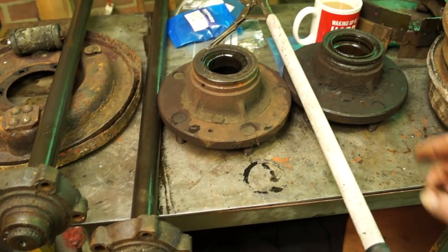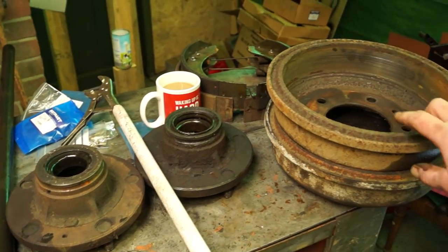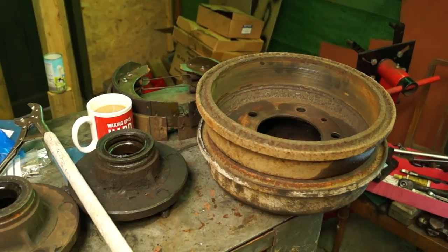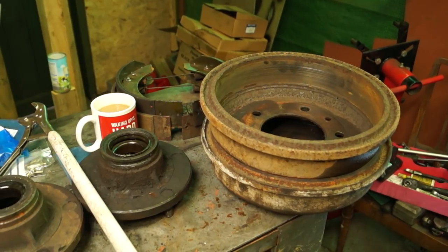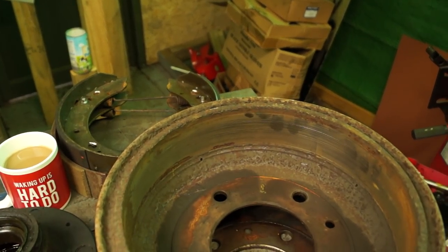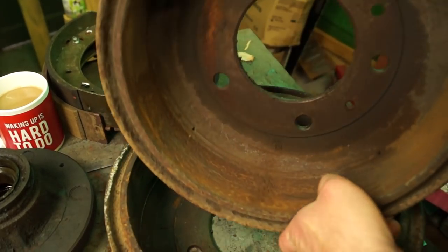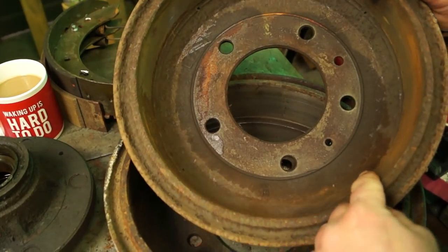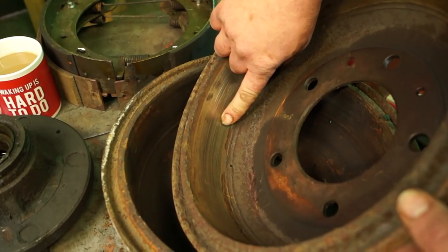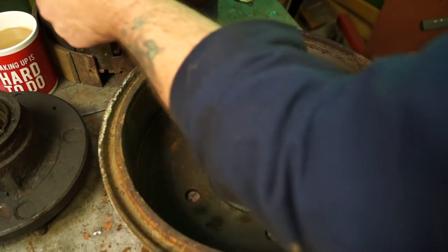I have the components laid out on the bench. I have a hub seal leak here — you can see that compared to the dry one. And then of course I've got the brake drums. The condition of the brake drums is very, very important, especially the working surfaces. I'll briefly skim over this first and then later show you how to measure the drums for ovality. It's been sitting a long while so there's rust in the bottom. The drum doesn't look too worn but it is scored — that really needs to be skimmed to give it a smooth working surface.